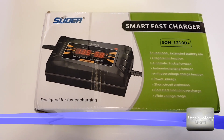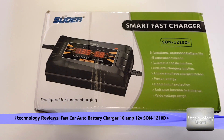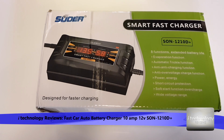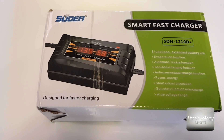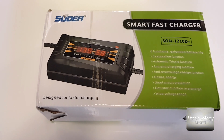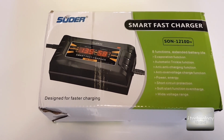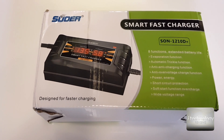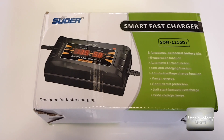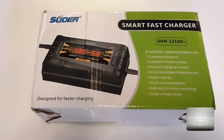We recommend if you have bigger batteries to charge them with 10 amps per hour. If you choose this fast charger for small batteries — let's say 50 to 60 amp batteries — it will deteriorate them over time. But if you use it in winter just a couple of times, this won't be a problem. The problem is when you charge them more often.